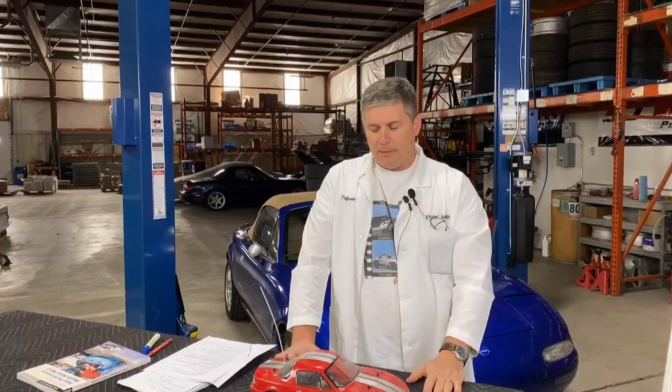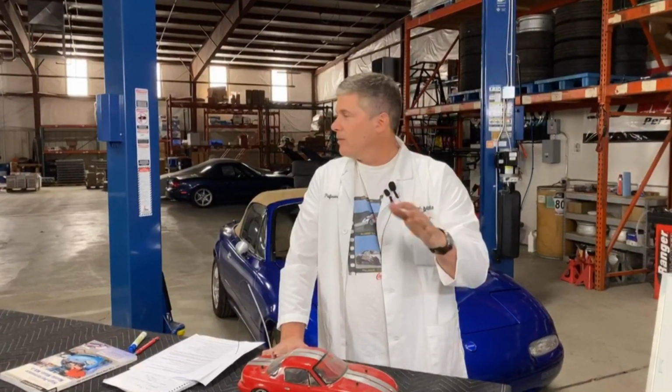But you have to watch out because there's both a wet boiling point and a dry boiling point. The dry boiling point, from memory, is right out of the bottle. The problem with brake fluid is that it's hygroscopic. It absorbs water out of the air. If there's water in your system, you've got a problem, but it will absorb that too. That's why it turns dark with time. I think at 3% water content it's considered to be wet, and at that point the boiling temperature can be considerably lower. I don't have brake fluid in front of me to come up with examples, but the boiling temperature could be 150 degrees lower on wet brake fluid than on dry brake fluid.